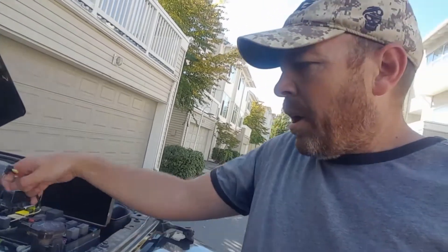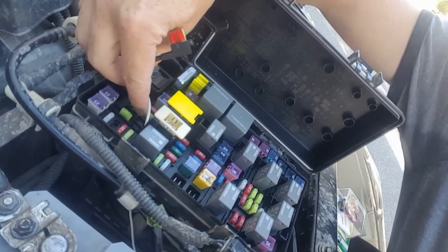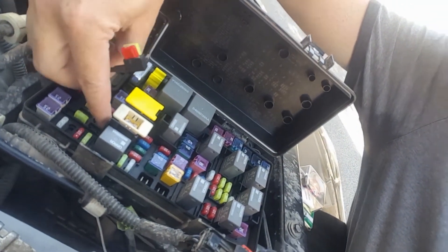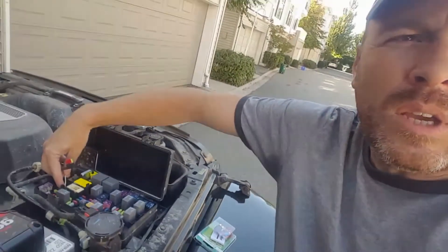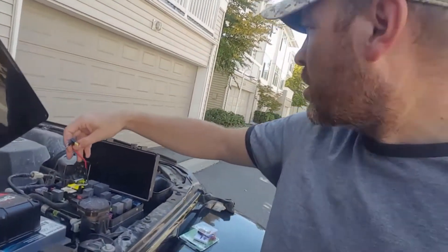This wire is your new circuit. In your fuse box, because it is weather sealed, there's a small hole down in here — you can see that right in beside this relay. There's a small hole in here and I fished a 16 gauge wire through there. So that's going to my accessory circuit.